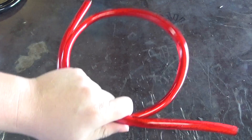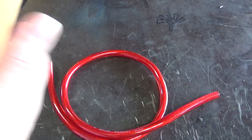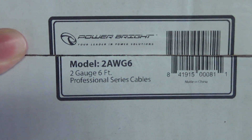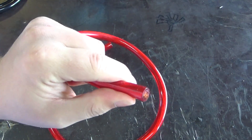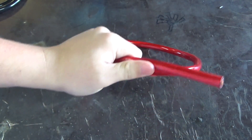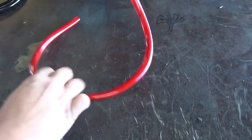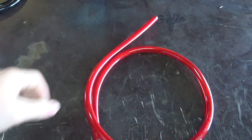So a little backstory on these cables — I purchased them in this Powerbrite inverter cable kit, that's the box they came in originally. But the ends of these cables weren't crimped on very well and they weren't soldered at all, so they actually just pulled right off. I already cut these up; they're about 3 feet long now, fairly short cables. And I'm just going to add another battery onto my solar generator here.